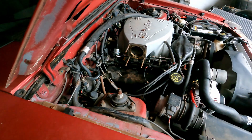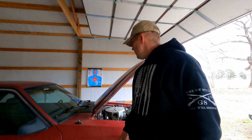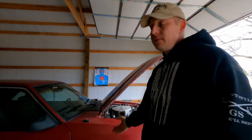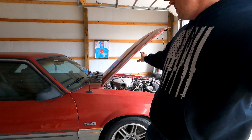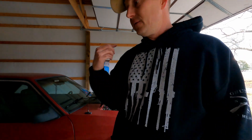The new fuel pressure regulator is in, vacuum line connected. It's not a complicated process, it's just tedious because you're using an allen wrench and it's upside down. I don't know who designed it that way, but the allen wrench heads face down and the fuel pressure regulator is the threaded side — don't know why. But it's done. At this point you'd put your throttle body back on, or if you removed the intake manifold, bolt all that back up. Anyway, another one down — if you like stuff like this, make sure to like, share, and subscribe. Until next time!